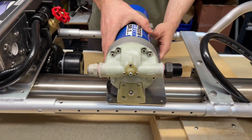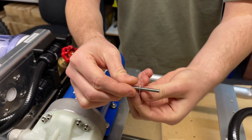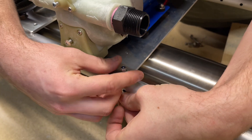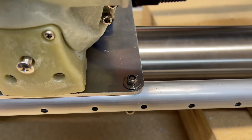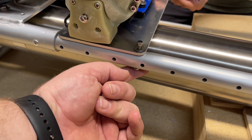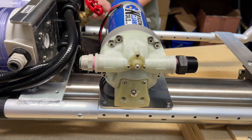Now that your holes are drilled, grab your pump and set it in place, making sure to line those holes up. Take your four bolts with washers and nuts. The bolt goes from the front side of the RO unit, then put the washer on and then the nylock nut. Be careful when tightening up these nylock nuts — they have a small nylon ring, and if you tighten them too fast they can gall up and get a little bit stuck. Tighten them nice and slow. Use the Phillips head screwdriver on one side and a shifter on the other to hold it as you screw it together. Once all bolts are in, you can stand the unit up and tighten them that way if you prefer.